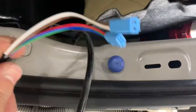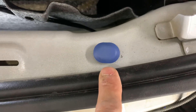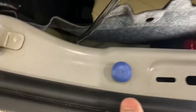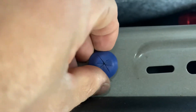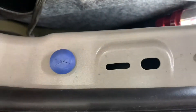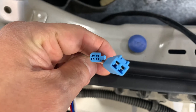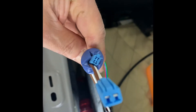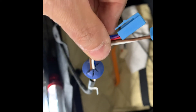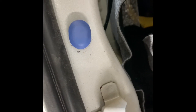The next trick: you'll need to push these wires through the grommets we pulled. The one on the left-hand side is a small circle; the one on the right-hand side is a bigger oval, which makes cutting and getting the wires through a lot easier. For the smaller one, I recommend multiple cuts — I've done a cross and then again, so it opens in three different directions. Start with the bigger connector, push it through first, and that makes it easier to push the smaller one through afterwards. I managed to get those through fairly easily, then slide the black outer sheathing back to the grommet hole for weatherproofing. The right-hand side grommet is a lot bigger, so it'll be much easier.